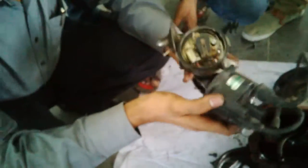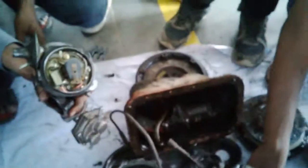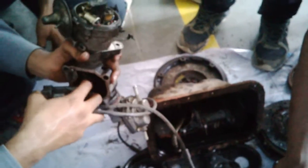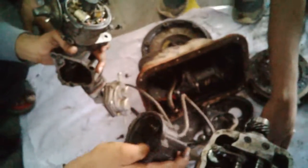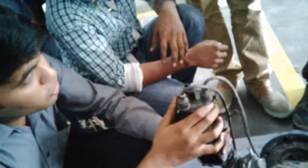Now, at the top of this part, the distributor body is mounted. From the center, current comes in to this pin. This pin touches this pin, so there's current on this plate as well. As this plate rotates with the rotation of the engine, it touches all these three ends, and this is how current distributes. Sometimes current goes to this one, then first, second, third, for three spark plugs. And these ends go to your cylinder body, the spark plug end. This is called the distributor cap, and it distributes the current to your engine.